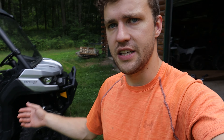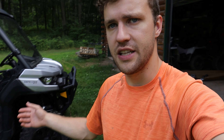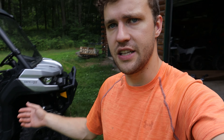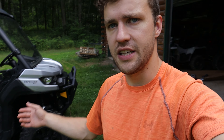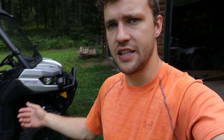I got this side done finally. Everything was going good until I got to this piece. Not sure why it's like this — if it were me I would have kept the same bullet look on this piece. They're hiding bolts here, and behind this panel you actually have to bolt it to the plastic, and that was the hard part. The holes that Can-Am provides — the little dots — do not match up whatsoever with this piece, so you actually have to mark your own holes. That's pretty tough because the space is very tight.